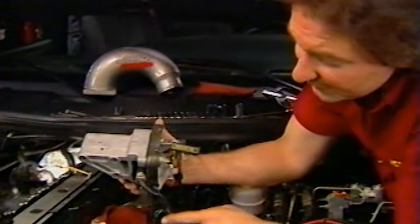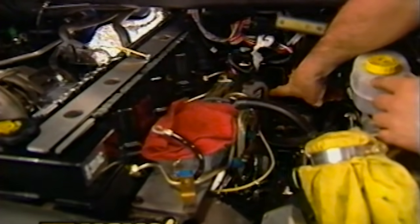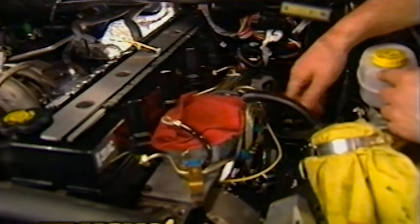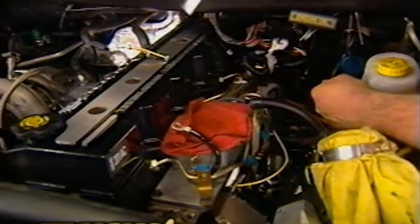Now it splices right in line here and goes to the throttle position sensor. It does the same thing back here with the map sensor on the intake. Then finally, we're going to hook up a ground to this bolt and finish off with our thermocouple wiring.